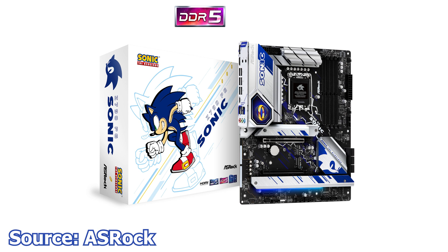When it comes to technical features, it's good stuff. The main PCIe slot is the newer PCIe 5.0, and one of the M.2 sockets is also PCIe 5.0. For internet access, you get the Intel-made Killer E3100 2.5G network controller. The highlight of this motherboard is the VRM system, which has no less than 16 phases in a 14+1+1 configuration. As for the price, nothing is known.